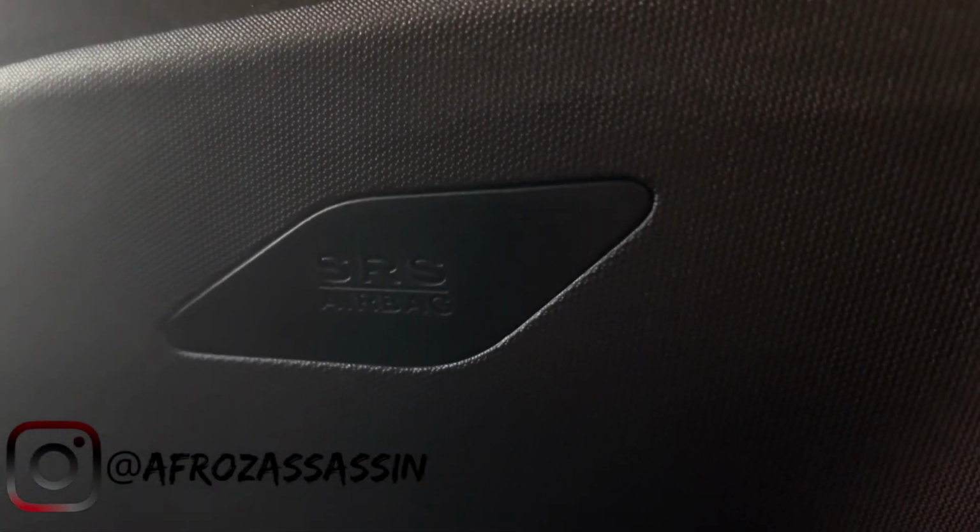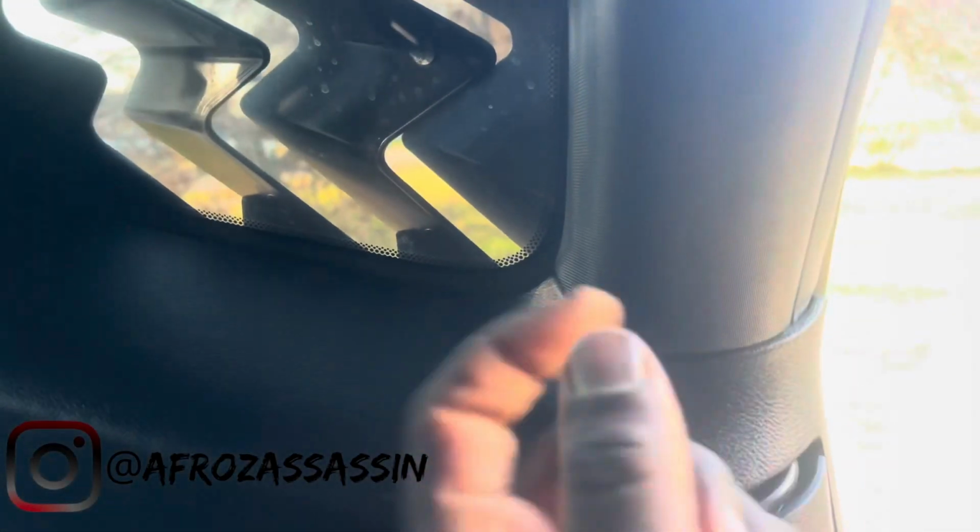Okay. Yeah. All right. Hard to see, but that's a 7mm bolt. After you pop off that piece, right in there should be another 7mm bolt, and I could take this whole entire piece out. Once I take that whole piece out, that'll give me the access that I need. I don't think I need to remove this other than pull it apart from the body itself to gain a little wiggle room to get this whole piece out, and that should be that.